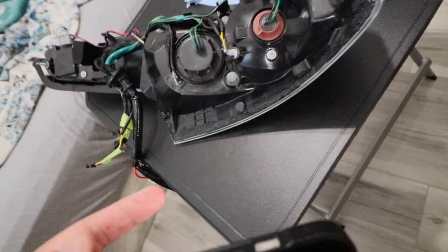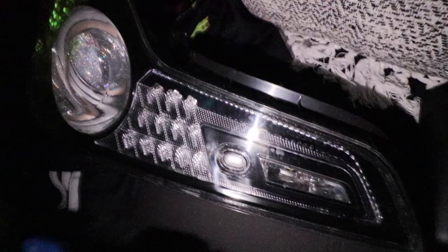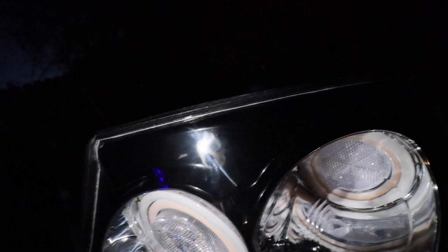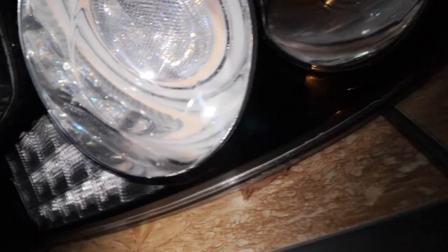Alright guys, it's now nighttime — quick update. I went ahead and resealed the taillights, put them out in the sun, and they were condensing again — a little bit less than last time, but still condensing. I brought them back in, added even more silicone around it, and took them back outside. I even warmed the taillights up inside my room, heated them up, made sure the taillight was hot, then took it outside in the super cold to give it the maximum condensation effect. Let's go check — this other taillight wasn't condensing and it looks fine. The one we fixed... right there, a little bit. Damn. And right there underneath the halo too. Let's bring it in and try to reseal that bottom end.